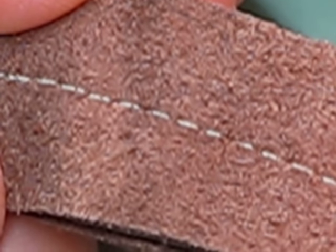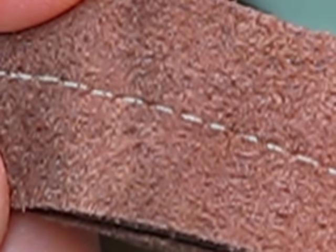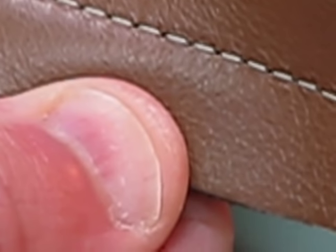And yet, because of the way that I've restored and resolved the issues with Erin's Husqvarna Viking Type 21 with that 1.5 amp motor, it showed grace to me and it said, you know what, you're using the wrong needle there, Master Sewer Scott, but we're going to make it right anyway because of the other work that you put into this machine. That is an absolutely gorgeous lock stitch. And again, looking at it from here at that top stitch, that finishing stitch right there, try to move it all the way across. That's exactly what we're looking for, folks, right there. That's exactly what we're looking for.